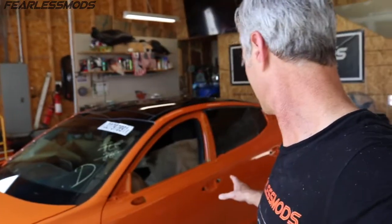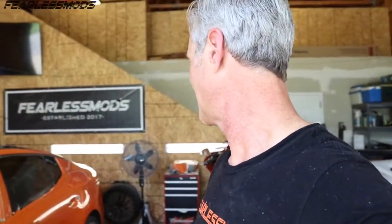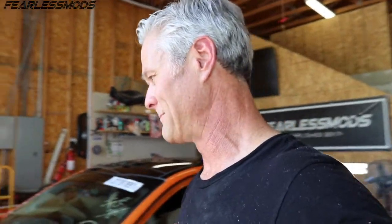There you have it — we've got the clear coat sanded, wet sanded with 1500, 2500, and 3000. We did a compound coat, a polish coat, a swirl remover, and buffed it to a nice shine. Now it looks complete — this paint job looks fantastic. That's going to be it for the main part of the paint. We still have a little bit to do here and there with black trim for the windows, maybe a little work on the side skirt — paint or maybe not. But it is time to start assembling things: bumper, door, hood, getting everything final adjustments and put together 100%, and then it's just trim work. She looks fantastic — super happy with how this turned out. A good paint job for me here in the garage. There's a little bit of trash here and there, but so much better than the blue car. Couldn't be happier with a second paint job and how well it sanded out and corrected.